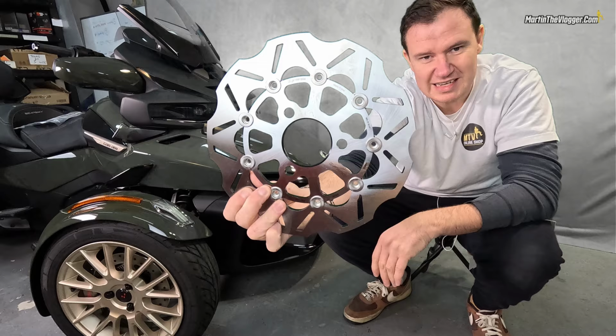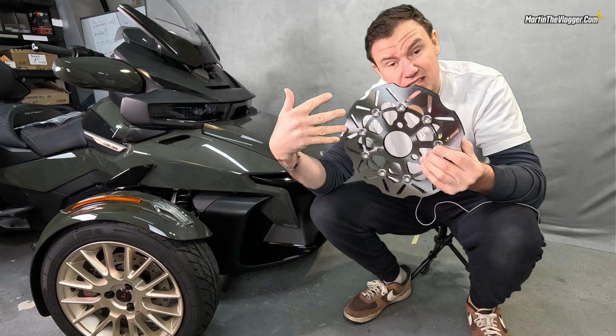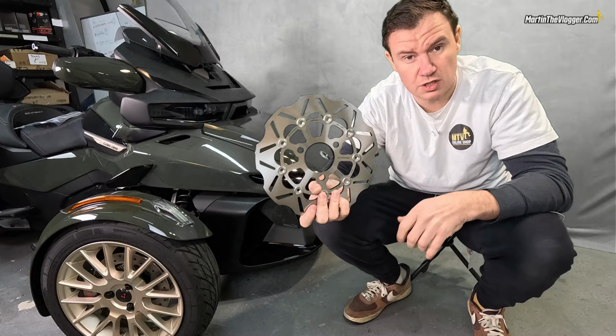More important is that there is much less dust. Apart from heat distribution and cooling down, there is much less dust catching on this. There is much less water catching on this. Much faster evaporating of the water. So braking under not dry conditions is much better, all right? And of course the cooling of it. So these things we will throw in